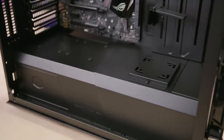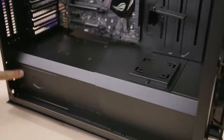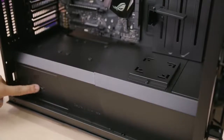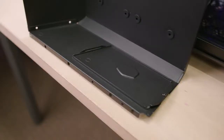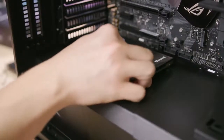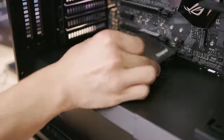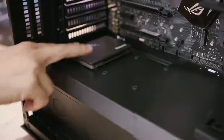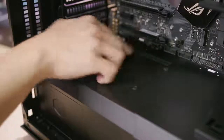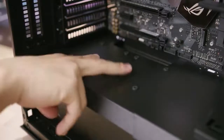Taking a look at the lower half of the case, we get a very nice power supply basement that spans the whole length — it's actually a two-piece shroud. The rear area has a removable piece with a Cooler Master logo but no actual branding; you can pop this out if you wanted to show off your power supply's RGB. On top of this part of the shroud, we get rubber pads for two 2.5-inch drives. If you want to mount a pair of SSDs here so they're visible through the side panel window, you can use the same peg mounting system.